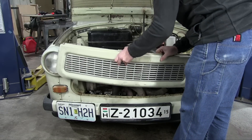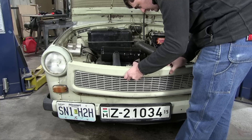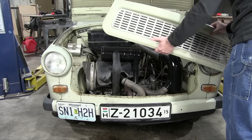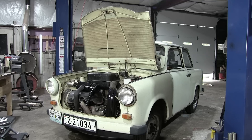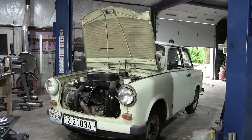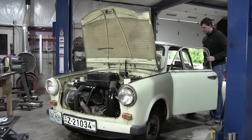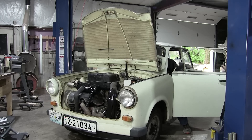Put the face back in place. That carburetor is dripping something awful — I'm thinking the float's stuck. Take the face back out. Yeah, it's just flooded in there. You know what, forget it — I'm getting too anxious. I'm going to try to start the Trabant anyway with whatever residual is in that carburetor. I had to shut the fuel off because it's leaking, but I want to hear it run. So let's just go at it. Do I choke it? Does it matter? Let's try it.